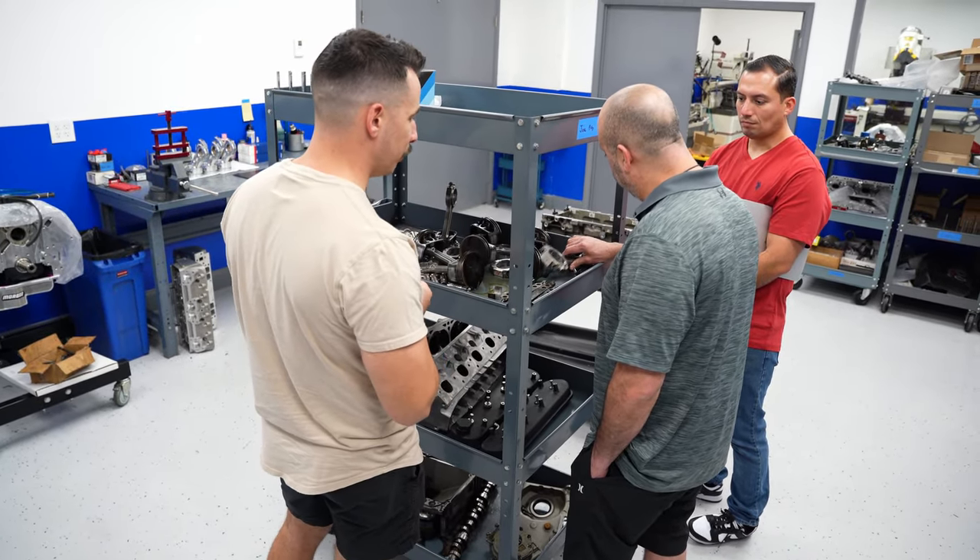We don't have to change the bore, pistons, or sleeves or anything? No — well, we're going to hone it. Yeah, we're going to hone it 5-0. We're definitely going to do that because we want to start with a straight cylinder wall. The whole deal is not to patch it up — the whole deal is to have a new engine. If you start just trying to throw a piston at it, yeah it'll be good, but it won't be brand new. We'd have to hone it — it's good to start fresh. The best chance this thing runs and drives the way it's supposed to.